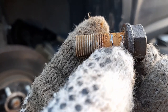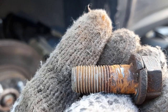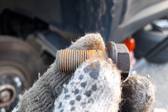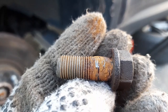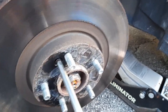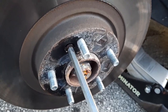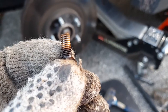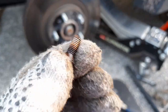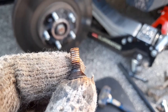When you look at the thread it's quite a bit rusted, so I gotta clean it nicely on the wire wheel. Right there it's a lot of corrosion. I'm gonna take that screw out but even that one has a lot of resistance — it should be easy once loosened but it's really hard. I got the screw out but it's very rusted, that's why there was resistance. I'm gonna clean it up and put a little bit of grease on it — I thought I was gonna break it off.